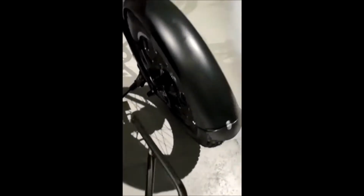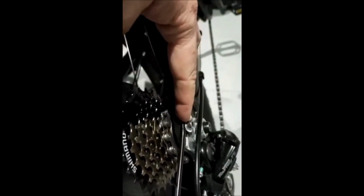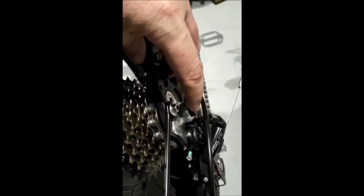If you just line the rack up with your bike, you will see that down the bottom here, this screw goes in and holds the brake and the rear rack. So that screw there we're going to remove, and also the screw this side where the rear mudguard is. So we're going to pop those two rear mudguard bolts out, and then we are going to attach the rear rack to these bolts.